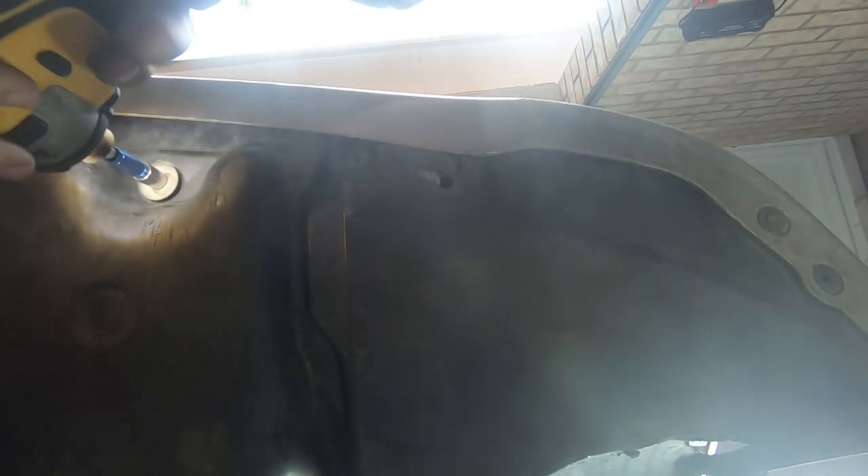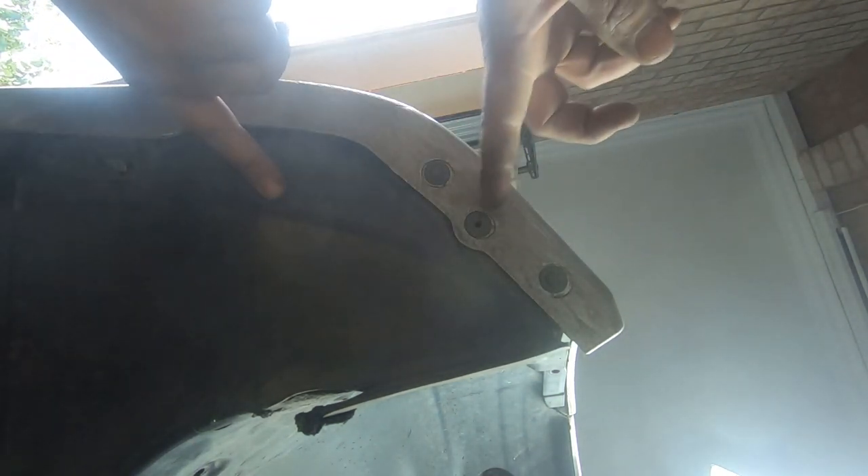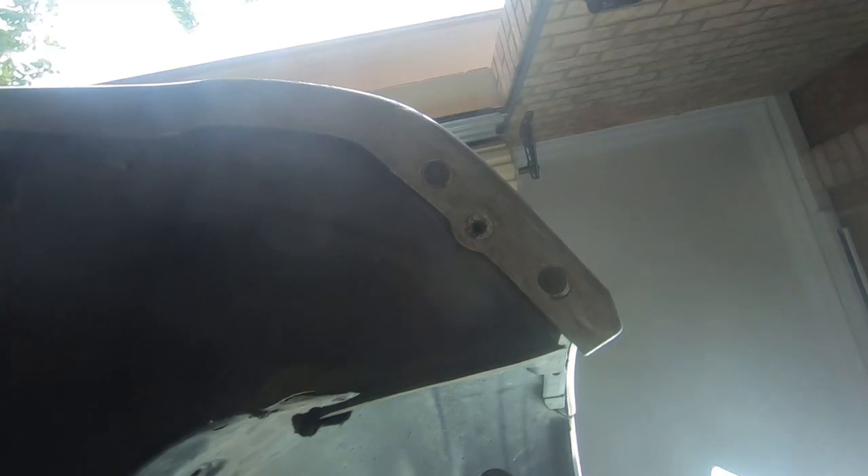We can then work on removing the side clamps that hold the front bar to the side fender. I'm going to remove this 8mm screw here. And then there are two push clips left to remove. When it comes to these three, I know it may seem like you need to remove all three of them in order to remove this piece, but you don't have to — you only have to remove the center one. So we'll remove this middle one and then this one right here. And now we can remove this piece.